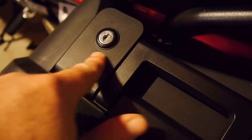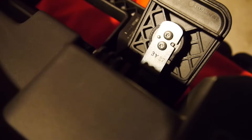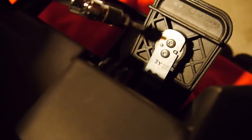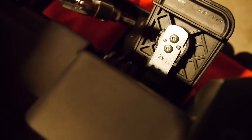In this particular case, this happens to be my FJR, but this is going to apply to virtually all bikes out there because all these locks operate the same way. What we have to do is remove the cylinder from the saddlebag. In my case, there are two little T10 safety torx screws to remove, and this plate will come off the bottom of the lock cylinder. Be careful because it's ready to slide out at that point.